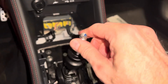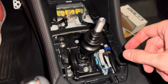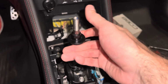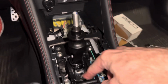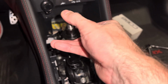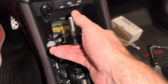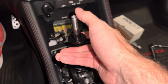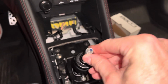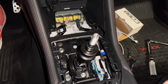There's second. I really don't want to go tighter than that. It's pretty close to third gear. They're already torqued down. That's pretty good. Here's an example: if I pull up on the reverse lockout, which is what's really running into that COBB stop, look at that play. If I drop it, so that's a pretty significant difference. There's still a little bit, so I feel pretty good about not making it difficult to get into gear.